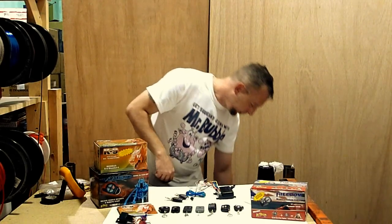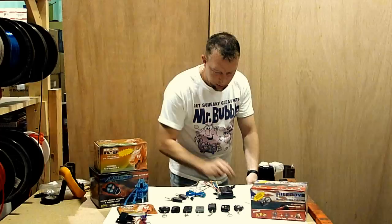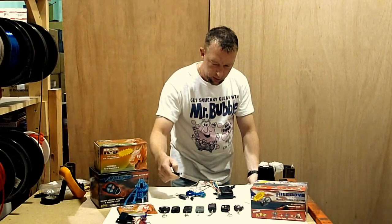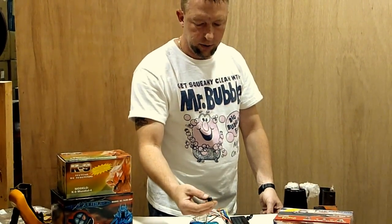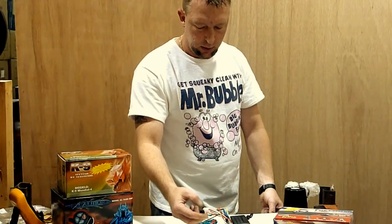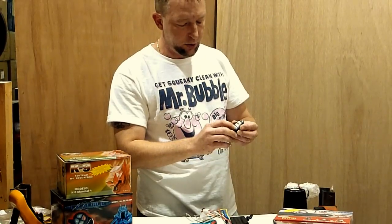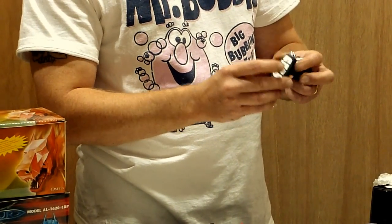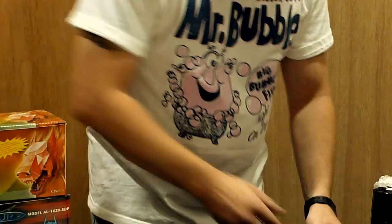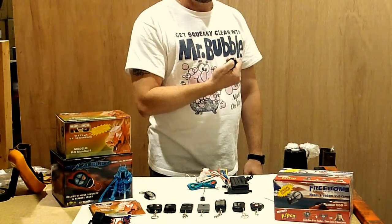With that said, I'm going to turn my car on. Find that valet switch and push it five times - that's what it's going to do, it's going to chirp real quick. Now, on your transmitters, most of them it's usually the lock button. On these, which is the newer 2011 model, you have to hold down this two button. It's going to give you that confirmation chirp that it learned the remote. However many remotes you have, do it on all of them. I only have two - I programmed the two, as you heard. Turn your key off - you want to hear that sound right there.